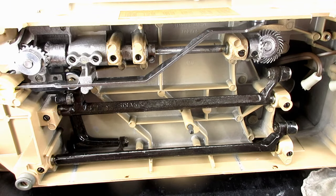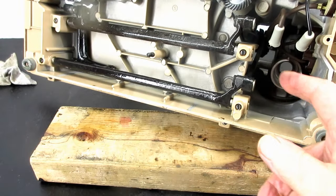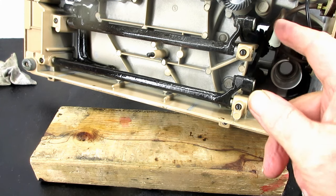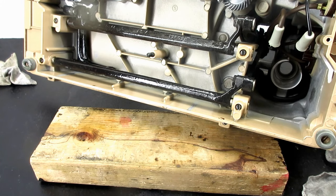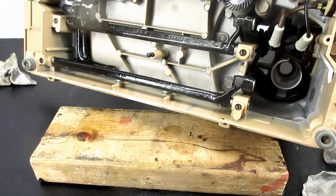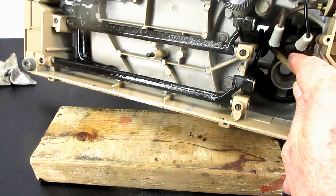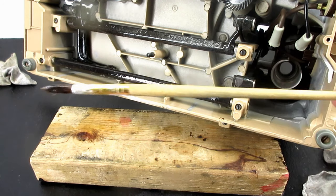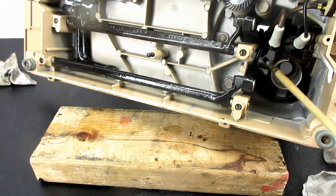Now, up inside is the feed rock shaft and the feed rock lifting shaft. That's what moves the feed dog, these two. One creates an oscillating movement to move the feed dog front to back, and the other raises it up and down, okay? By cleaning that off in there, we've left the metal bare, and I like to reach up in there and put a little oil on that shaft. With a brush this size, you can reach all the way up to the bottom of the arm shaft on top and just drag that brush over